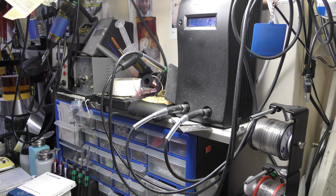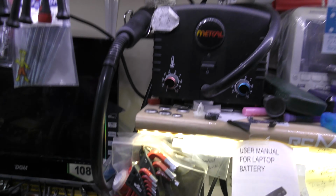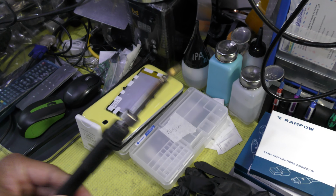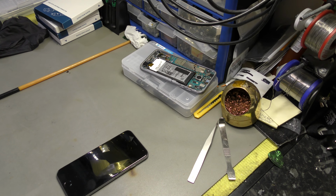So there's even more to do the phone repairs. If you look here, this little hot air station, I've got one there, that one, and I also have this one. Why the need for two? This has a smaller tip, a very small tip, so I can go in on any PCB on any small area and remove components with the help of that. And that was about £600. The cartridge and nozzles were another 40-50 quid. Bent nozzles, that didn't come with bent nozzles. It came with straight nozzles.